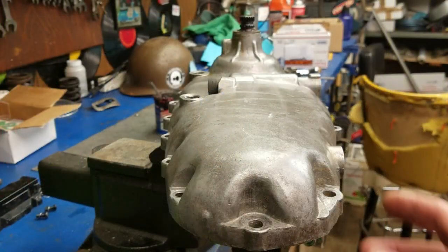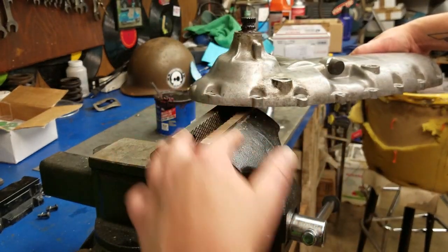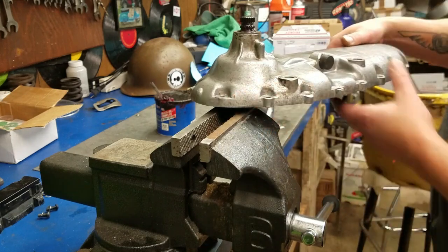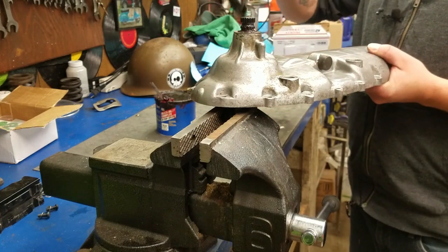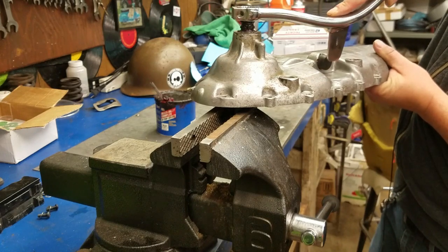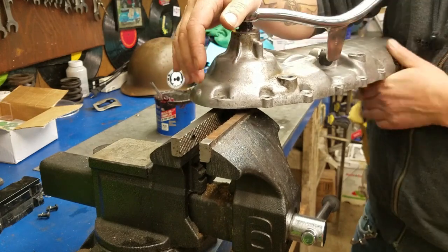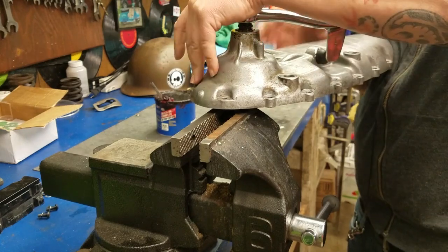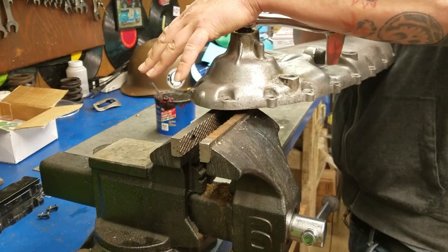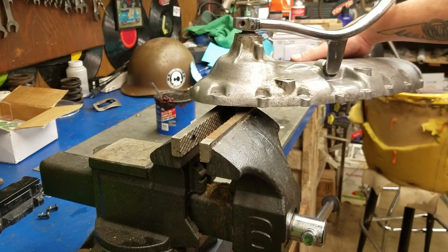All right, the easiest way to preload it then is gonna be just to turn it, and then if you remember how you clamp that in, you just want to line that up about here on the case cover. And then from there, you actually just take your Kickstart lever and drop it on. And there we go, we are preloaded.